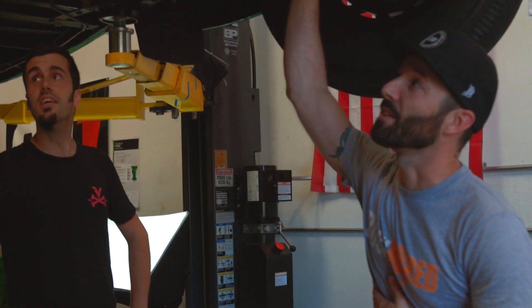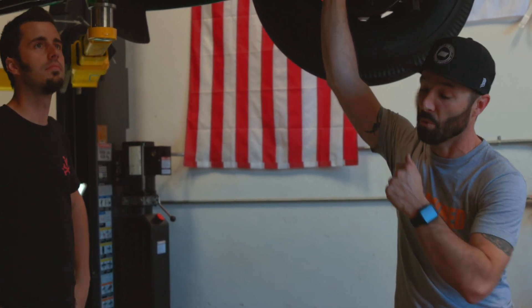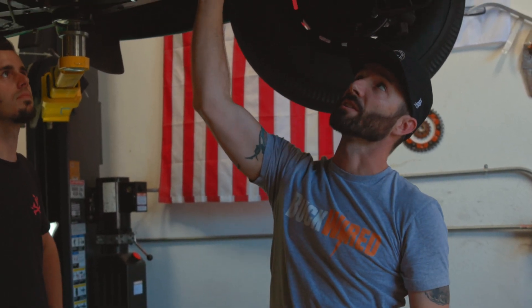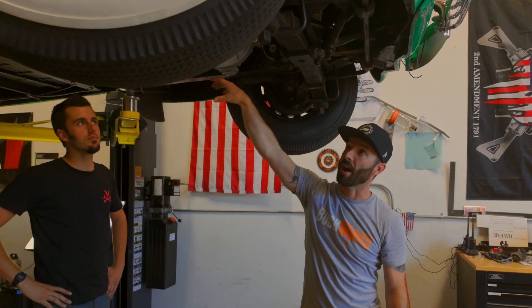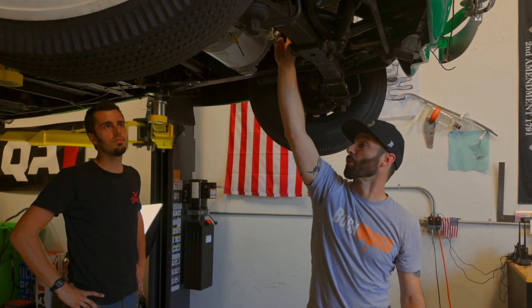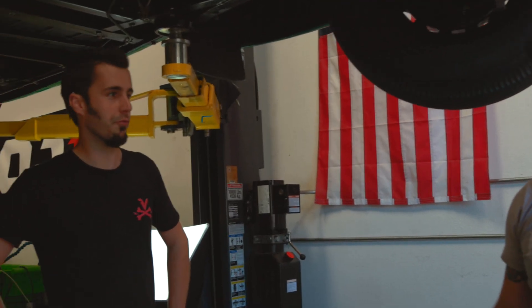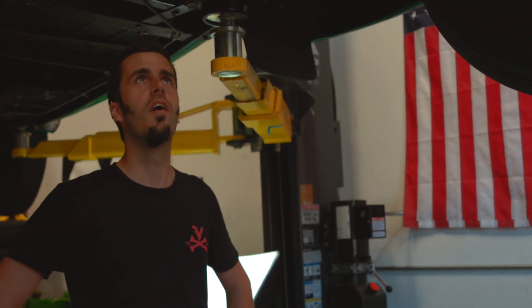Last time you guys saw this car, everything was taken out of it. There's been a few more things taken out, but also some things put back in with the new EV setup. What we have here is the motor and all the step-down gears. The mass of the motor is nice and low, behind the line of the wheels, and then you have your half shafts going to your step-down ratio. You keep all that robustness with your stock differential.